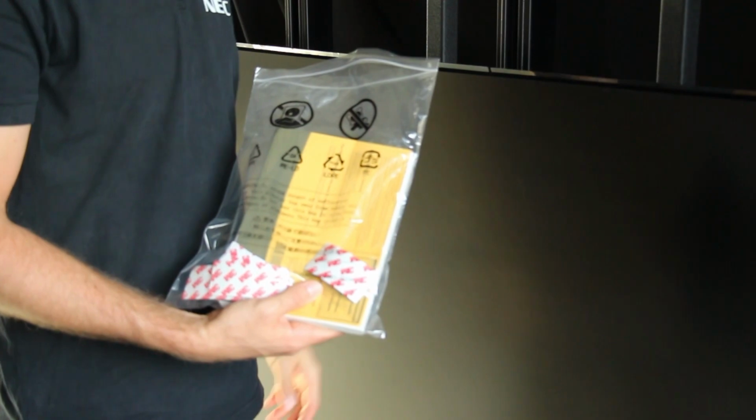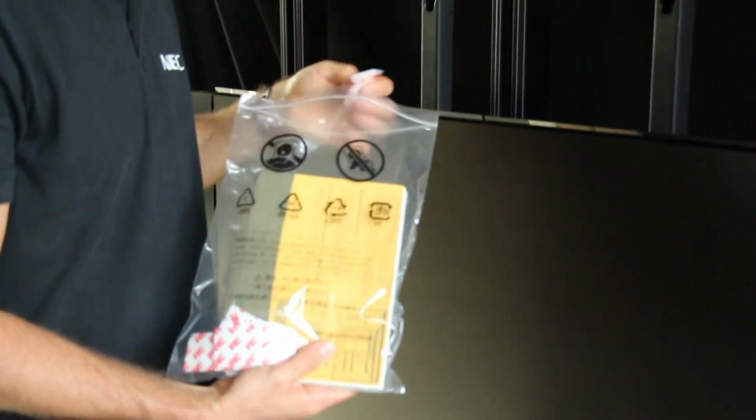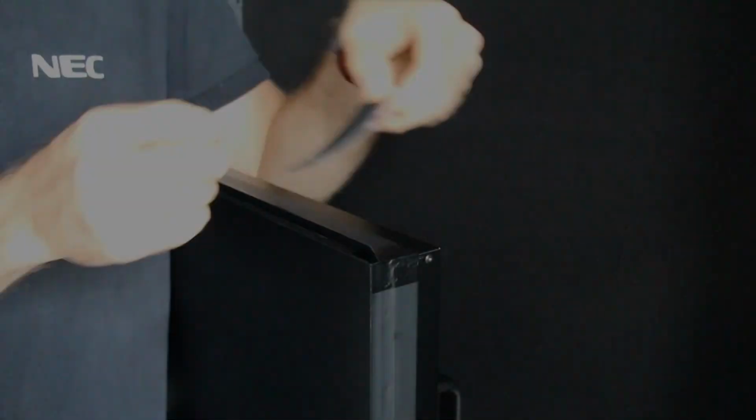On the upper edge of each display, you will find a folded protection stripe. Unfold it towards the front for protection from the display to be installed on the top of this unit. Take the supplied spacers and place them flush at the back of each corner, which will have a display next to it.